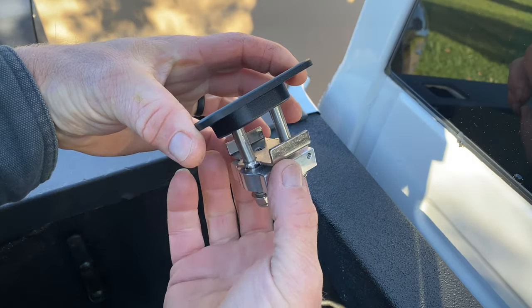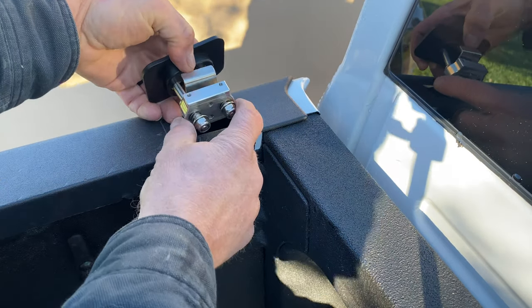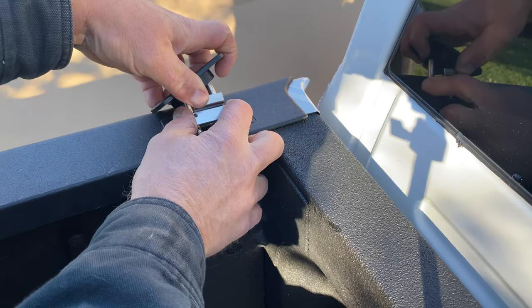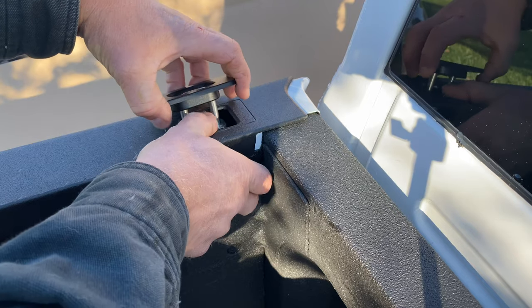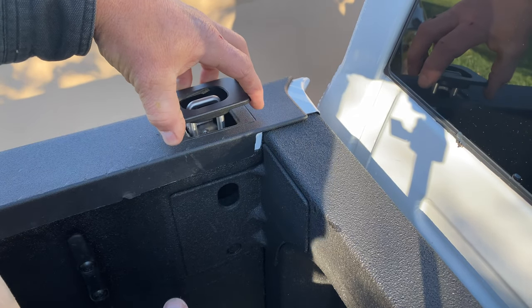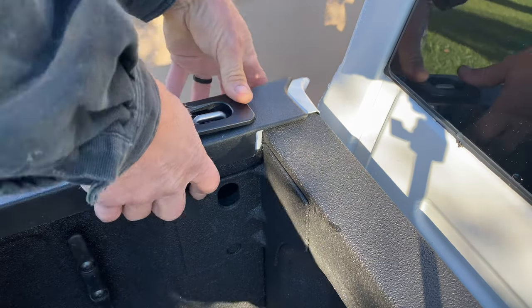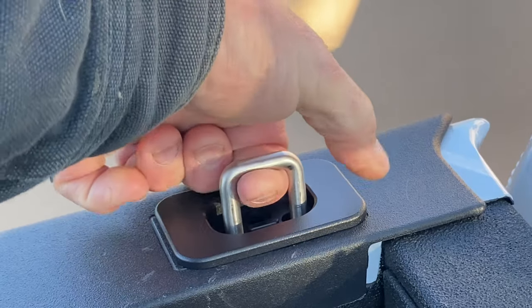You can see everything's real loose now. This is my hook that's going to go to the bed of the truck here and here. So I want to slide that in at an angle, and push the aluminum block into the bed. Then I want to try and center it up, and you can see that you've got to pull up on the cup to get it centered. Then I can push the top down into the plastic bed liner.